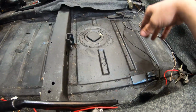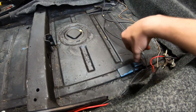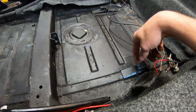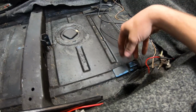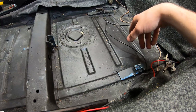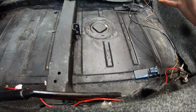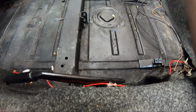also I'd have to do some sort of janky stuff, like I'd have to mount it to these, and that's just a 10 millimeter fastener, and I'm not really comfortable with that. In terms of safety, just a 10 millimeter bolt I don't feel is hefty enough. You know, in factory it was just two, and even that is not super secure, I guess, in my opinion. But, you know, it wasn't a race car, it wasn't built to go on the track and everything. So I think I'm gonna cut this out and then just go straight into the floor